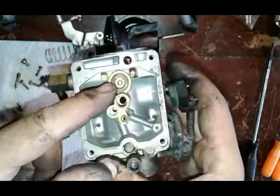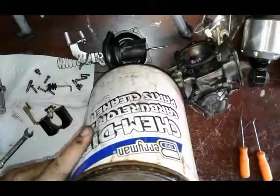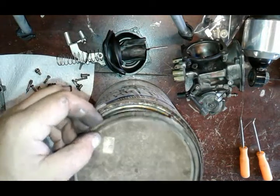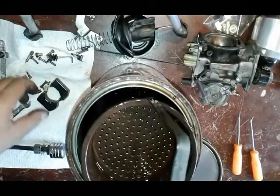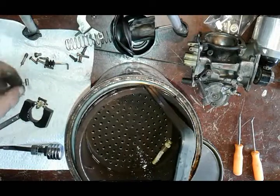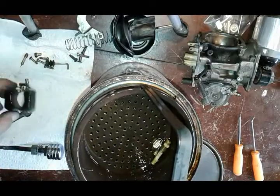Now we've got the body stripped down as far as we want to go. The seat for the float needle doesn't come out and the choke jet doesn't come out either. Next we're gonna dip our parts in the solution. What I'm using is this stuff — you can buy it at Walmart or parts stores, as long as it says carburetor parts cleaner it's the same stuff. Open the can — it has a little tray that you put your parts into, very handy. We're gonna put in the main jet and the idle jet. If you're not replacing the needle jet you can put the float needle in there too.